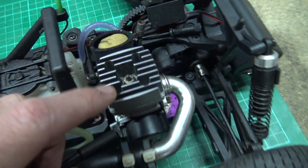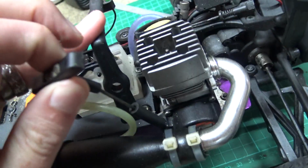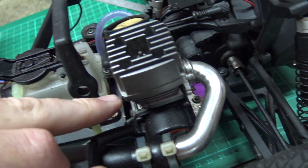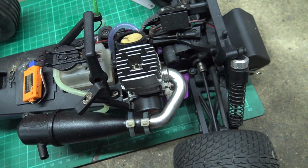So make sure that they're tight, and also when you pull it, be in a nice quiet area and pull it over, and you might hear a psst, psst from around the edge. You've got a leak if you do. Also, you might have a bit of fuel coming out, but just check.